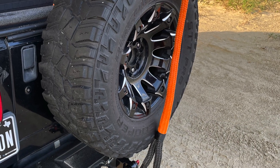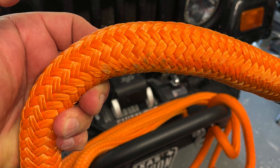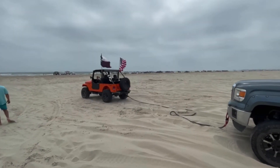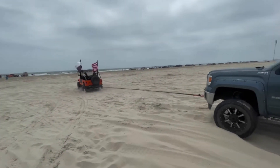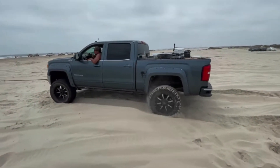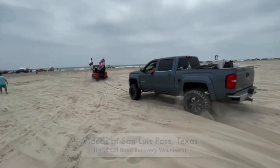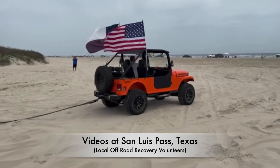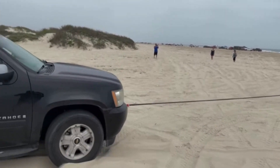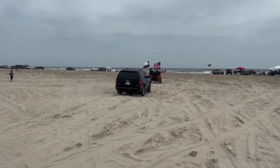Let's talk about the kinetic rope. In most cases, your kinetic rope is going to stretch 20 to 30 percent. Once it is stretched, the potential energy stored up in the rope — like kinetic energy — reaches maximum stretch and the rope transfers that stored energy into pulling the vehicle free. You go and let the rope stretch and that other vehicle is going to follow, usually in gear in drive, unless they're in a hole where you need them to be in neutral in the beginning.